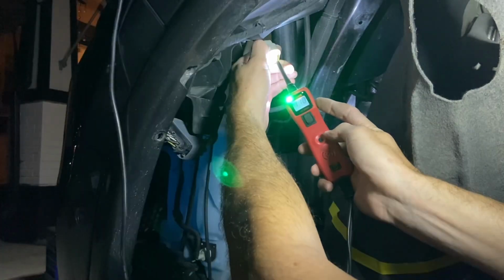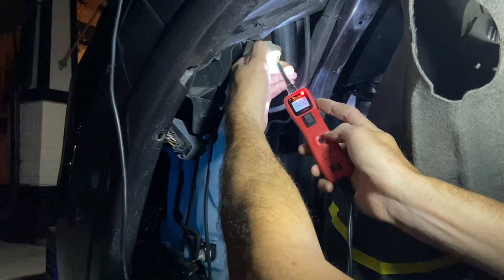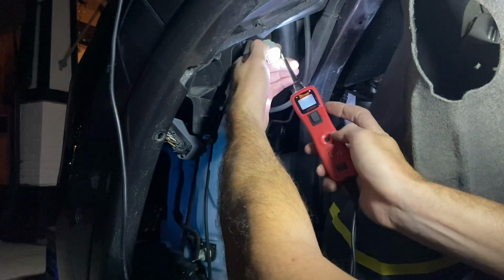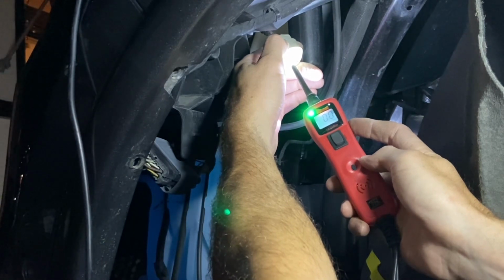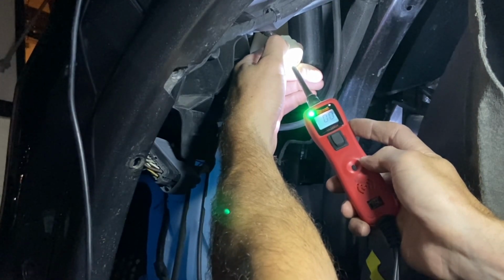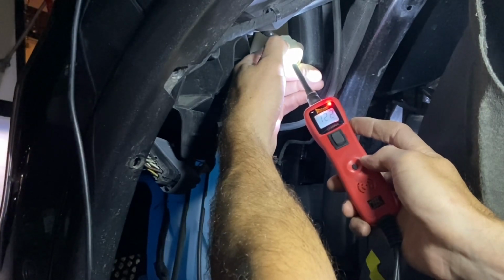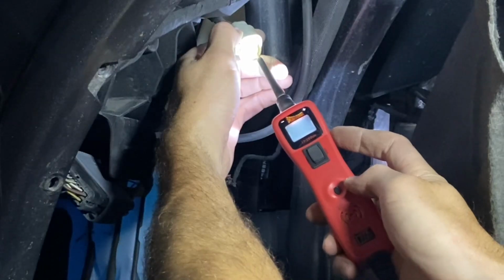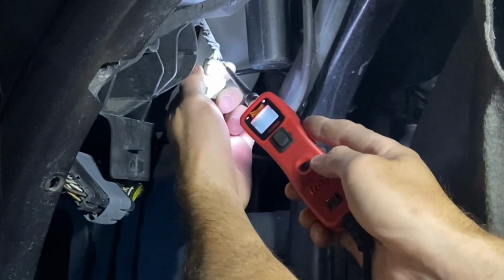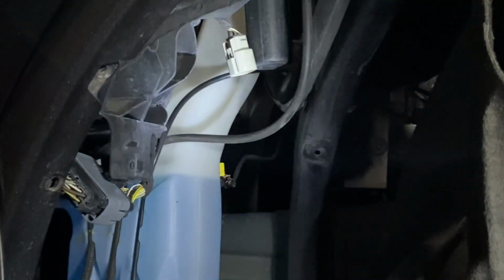All right, headlights on. Now the headlights are on and it's still on. Now go to running lights. Still on and then off. That's it. Now this one here, okay, running lights, headlights. You see how this one is on with the headlights, but go to running lights, then it loses power. So we wouldn't want to use this one. That's why this guy right here, your white with brown casing, is the wire that we're going to tap into to give us that same exact power result